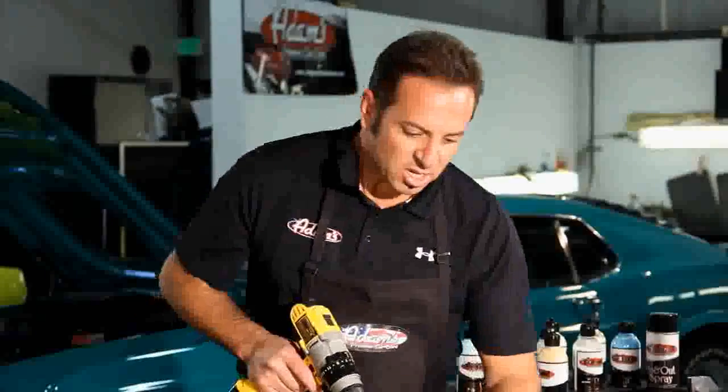And recognize, I always say, never polish angry. What? Never polish angry? Yeah. If you just get a scratch and you want to go get it out immediately and you're all ticked off and you want to grind that sucker out, don't do that. That's exactly when you burn. So you go easy like I did, over it once, over the second time. If you don't get it out, this process is typically a 3-round process at removing scratches from your clear coat, okay? Give it 3 rounds before you start to think touch-up paint or sandpaper or anything like that. 3 full rounds, green, orange, white, and then consider, let's go to the next step, because chances are 3 full rounds, you can get it perfect.